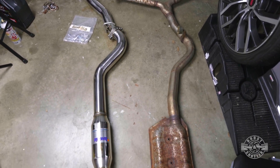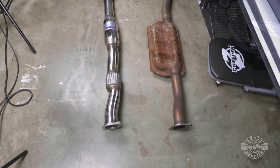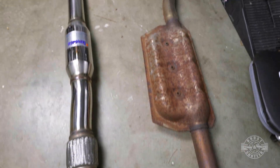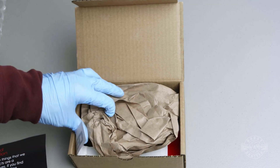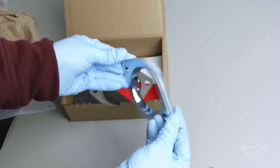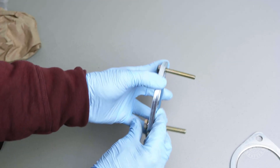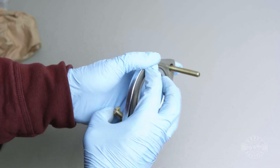The stock pipe diameter on the STI is 2.5 inches and this particular catback exhaust has a 3 inch pipe. You may have decided to just install the catback first for a change in exhaust note and then upgrade the downpipe in the future as a power increasing modification, which is perfectly feasible and exactly what I did. If you're just installing the catback and not also replacing the rest of the exhaust, then you have to get one of these adapters or you will likely develop exhaust leaks. As always I have links in the video description for this to make it easier for you guys. You're going to see why we need this in a second but it is assembled just like this.